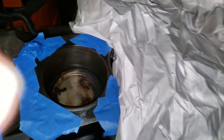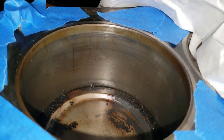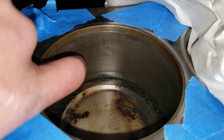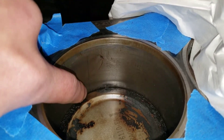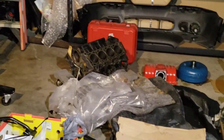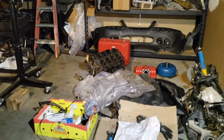When I was cleaning my engine, I noticed that cylinder number four had a scratch — you could barely feel it with your fingernail. So I was thinking about reusing my old roller followers and lash adjusters, and just saving the brand new ones for my backup motor that I plan on building after this one.